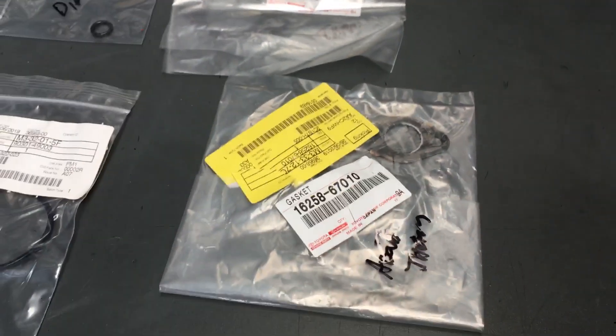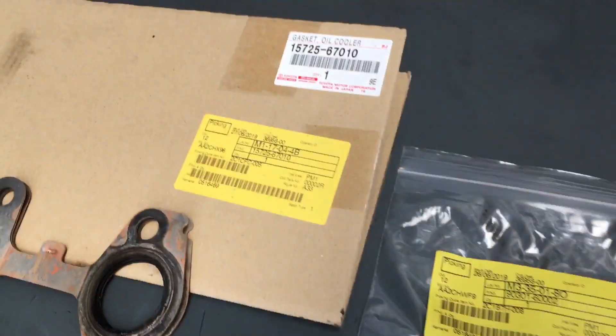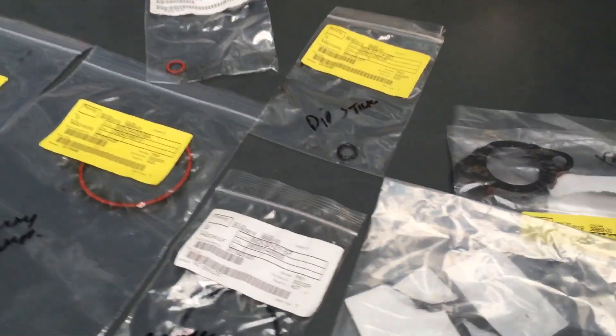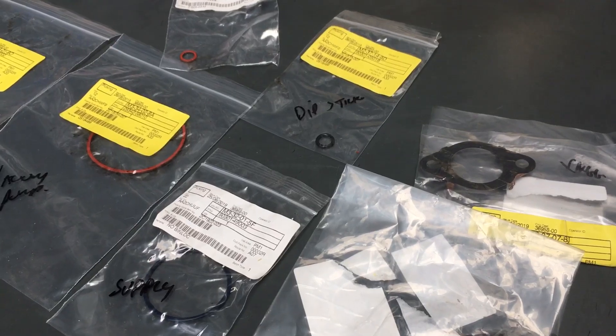That's a lot of the gaskets — there's probably a couple of others. Definitely need the turbo exhaust water cooler, you can't reuse that. You can't reuse the turbo kit either. Some of these o-rings you can reuse, but we prefer to change them. This one's looking a bit dodgy and it doesn't come with the turbo kit, neither does that. Those are most of what you need — hopefully it'll help me or you in the future. We'll call it: gaskets needed for swapping out a 1KD.